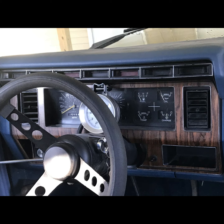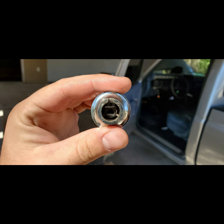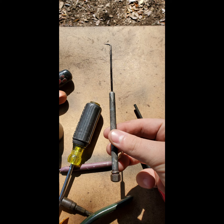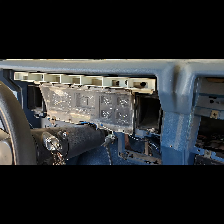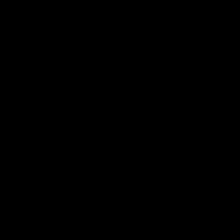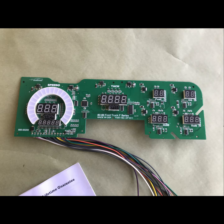So I have to take this ugly dash off. The first thing you're going to have to do is deal with the buttons on your dash — your light and your wipers. The wiper pulls right off. The light button has a little spring behind it; you have to bend the little tang back, there's a little slot, and it slides off. You need a little tool for that. Once you get the outside bezel off, you can see your full instrument cluster. It's only held in by a few screws — pretty straightforward disassembly. I thought I was going to have to drop the column, but I didn't. Once I pulled the screws, take note of that major plug on the right side of the column. That's the only plug that goes into that dash that runs your gauges, and you're going to go back to that for one sending unit wire.